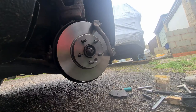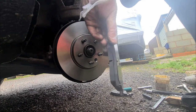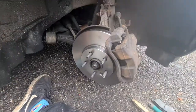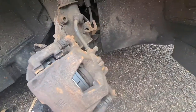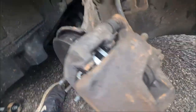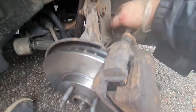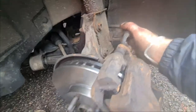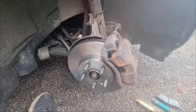Now they're nicely tightened, you can put in your brake pads. So remember what I said, the one with no latch goes on the outside. Alright, pads are on, caliper is on. That looks a whole lot better than before. And look at that meat. Jeepers. Last thing to do is you want to reinstall your brake line in this holder. Like so, and you want to get in the car and press the brakes a little bit to get rid of that gap. But then there you have it.